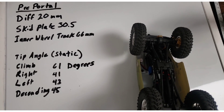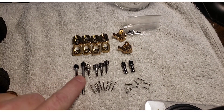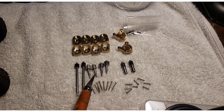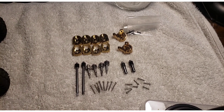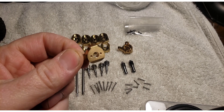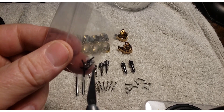These are all the things that are going to change when we start adding portals and changing weights, and I just want to make sure I have the basis for an apples-to-apples comparison. This is what the kit gets you: two rear drive shafts, two front drive shafts that come out of the knuckle, and four axle-side shafts with the little drive pin slot. You have eight long screws, eight short screws, four inner and four outer portal boxes — and these are machined so nicely they almost look like jewelry. You also get new brass steering knuckles and the hardware kit with sleeves for the hinge pins.